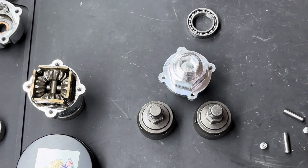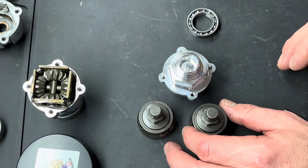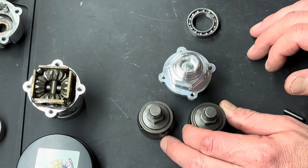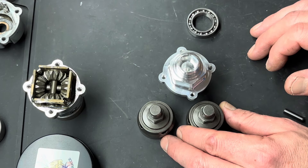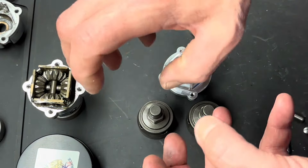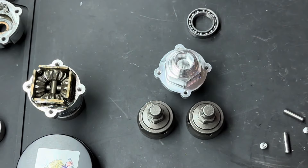I don't like diffs. I think you're better off with a locker because you're gonna deliver equal power to the ground — especially if you're a grass runner. Those guys that say it's not gonna turn — it is gonna turn, but it's gonna require a different kind of driving style. It's not gonna turn as easy. A diff does allow it to turn because you got that diff action, but with a locker you do not. You'll learn how to do it.